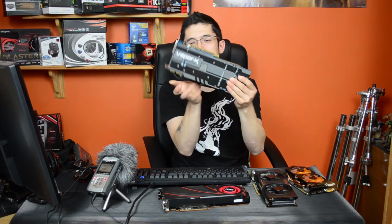650 watts. I mean, they recommend a 750, so obviously they think it can go even higher, or they're just playing it safe. But I remember someone on the last video for the 280X said they were using a 500 watt power supply for it, and it was working, which is fine. Don't try that with this. It's not going to happen. Trust me. You'll end up paying £400 or so for absolutely no reason at all. Bad things will happen. For less than all of these, you can get one of these.